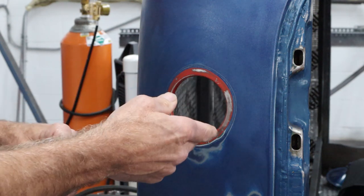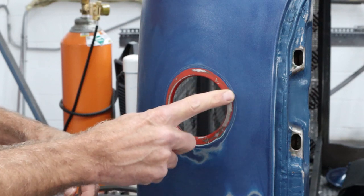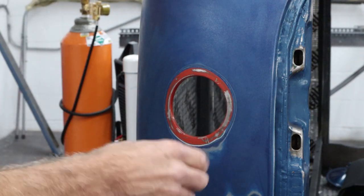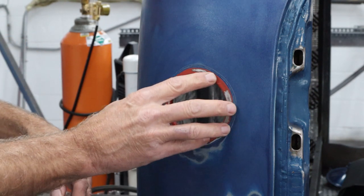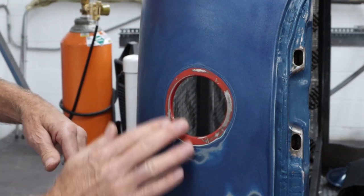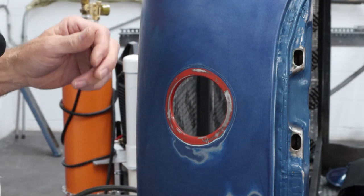Here's where the filler neck came out, and as you recall this truck has a lot of paint jobs on it, so there's a pretty good low spot around it since nothing was ever removed during all those paint jobs. So we are gonna be a little bit low anyway, but once we weld this patch panel in there we're gonna fill this and feather it right out to the paint - hopefully a piece of cake for once.